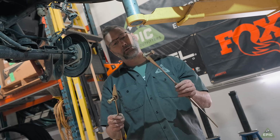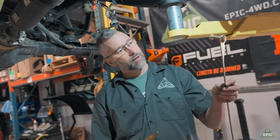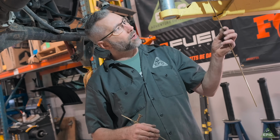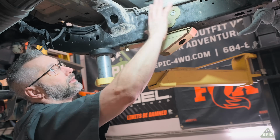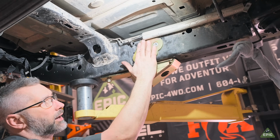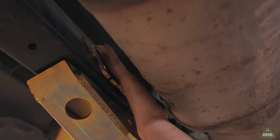So on the rear, since we've done the front one with the big flag nuts, we're going to move to the rear ones. I've already got one installed. So this one I've partially installed. Just be aware that the tank usually sits here, so the tank has to get removed so that this hardware can get put in, as well as the exhaust to get this hardware put in.